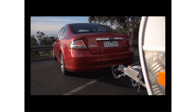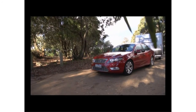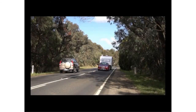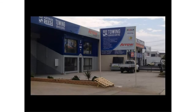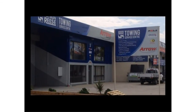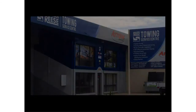Now that you're set up and ready to go, remember to always disconnect the spring bars on your weight distribution hitch before reversing. This will allow for tighter turning and will avoid any damage to your towing hitch. While correct set up is critical to ensure your safety and comfort, so too is the regular inspection and servicing of your towing set up. We recommend getting your towing set up inspected and serviced every 10,000 kilometres at a Hayman Reese accredited service centre.